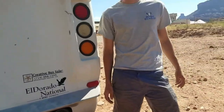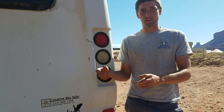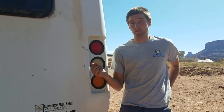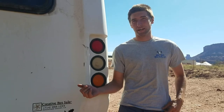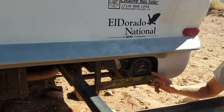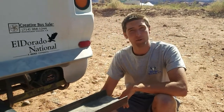The next form of power generation is a straight-up generator — a gas or diesel engine that directly turns a generator to produce AC power. These can directly power your AC appliances and also charge your battery bank. We have a 3000 watt generator mounted under our chassis, though I haven't hooked it up to our AC power system because the only reason I mounted it was to run our welder.